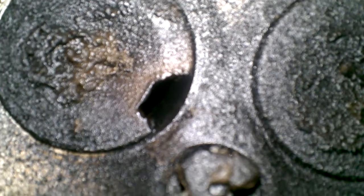What is a burnt valve? Well, the valve itself isn't actually burnt. I'm going to zoom in on my number three exhaust side, number three cylinder. The valve is actually chipped, and as you can see, there is a hole. This causes a dead cylinder and loss of compression. You can see the spark plug is completely trashed.